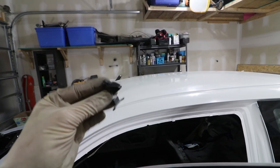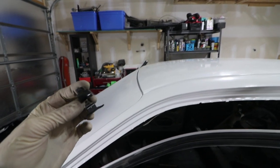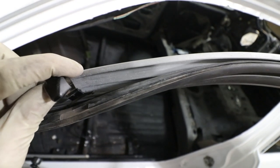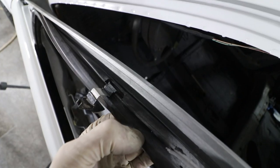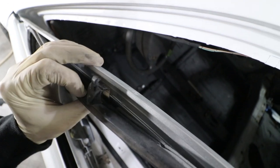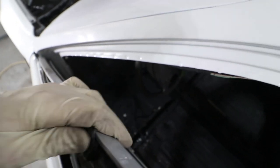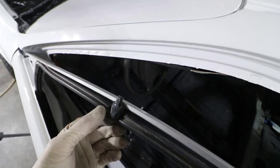Assembling the windows and weather stripping — this guide piece right here can be quite tricky. I haven't seen too many videos online of people doing this, but you can see there's an opening right there where it slides in. We're going to slide that in first and then clip it in properly. I'll show you step by step. So there it is sitting inside — when we put this back up we're going to push this down and clip it into position. We need to make sure the weather stripping is in the bottom position where it's supposed to be, then use a little bit of pressure. There we go.